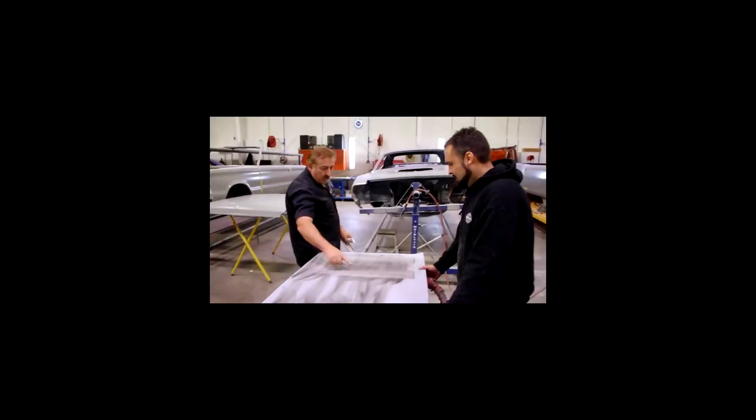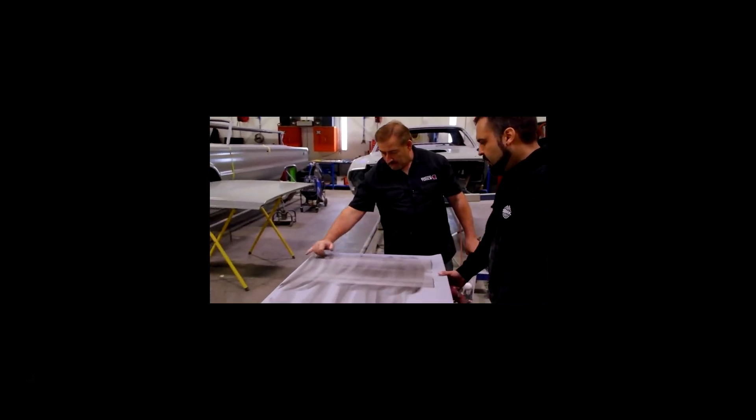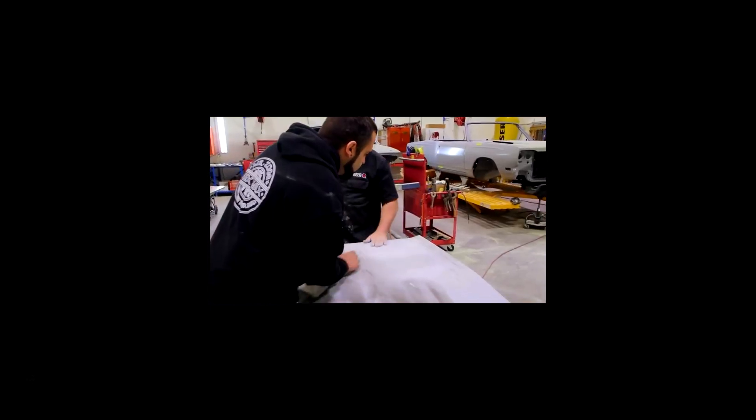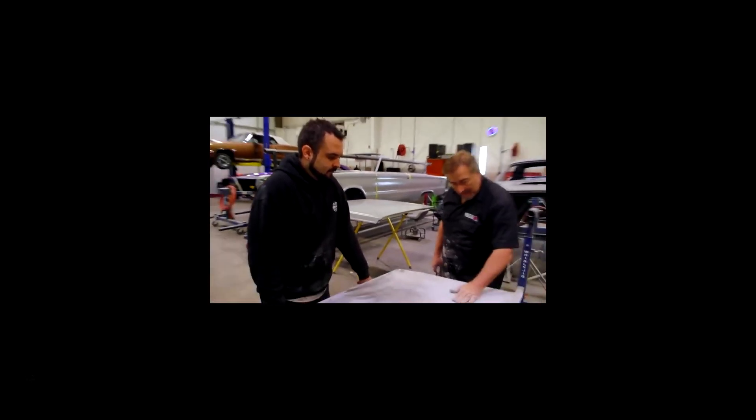It's cutting down nice out here, but not so nice in there. You can see it tapering out here — the puddle is right there. If you press too hard, you'll push right down in there and pull that guide coat up out of there.